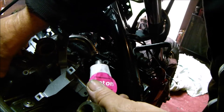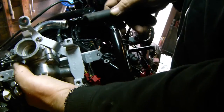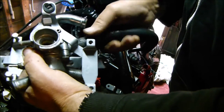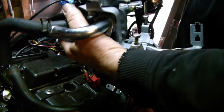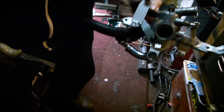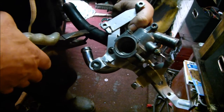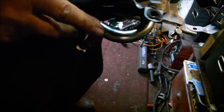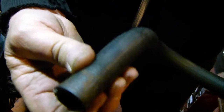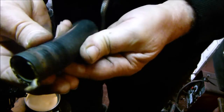I'm going to put a bit of rubber grease on them. Right, we could push that onto there. Then we need the clip — it's one of those springy clips. Let's take that around to there, drop it onto there, and then we're going to do the next one. One end had a jubilee clip and the other end had that springy clip — you can tell that's the springy clip from the shape it's left.